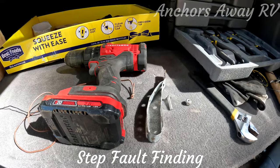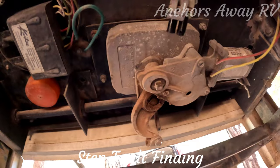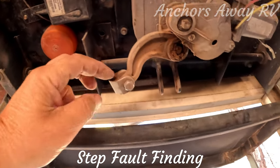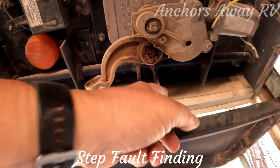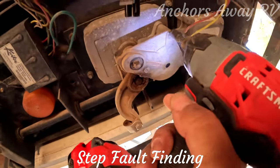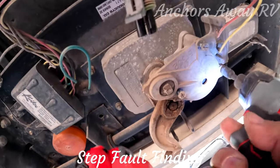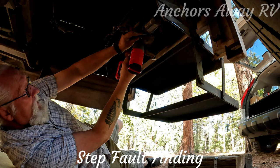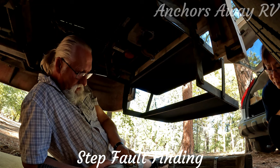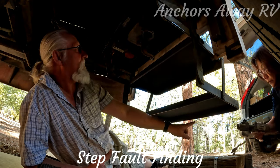I'm not going to discard these because chances are I'm going to need to put it back in, since we're way out in the middle of nowhere. If it is the motor, we'll have to go to an RV place and buy a new one. I removed the pin — it goes through this piece here which sits inside the stairs. I'm going to take these three bolts out and that's going to drop the motor off. These appear to be 5/16. There's the motor.